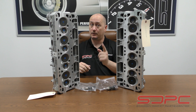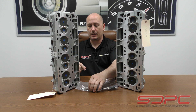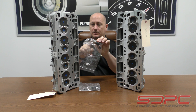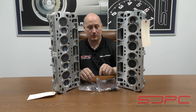Except with this one, because this cylinder head has had a design change where they've gone from a seven and a half millimeter stem down to a six millimeter stem. That's a problem because that's definitely not going to fit no matter how rowdy you get with it.